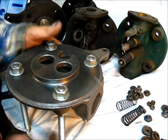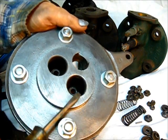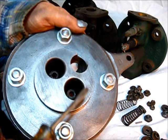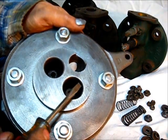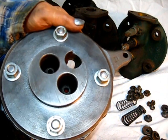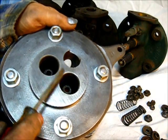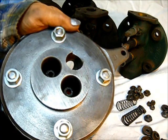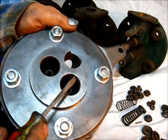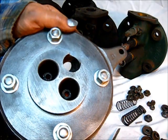This head here, if I can bring it to your attention — it's quite good. It has a very narrow seat, indicating that this is probably a factory cut seat. I don't think this head has been repaired, ever. It just indicates it being in good condition. After you cut this seat, either with a stone or a lathe or a mill, this seat will get wider. This is pretty much optimal right here.